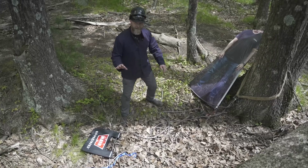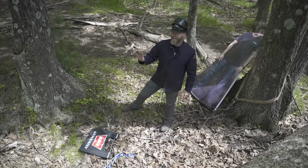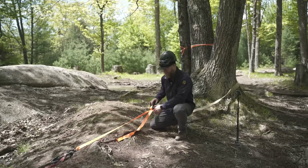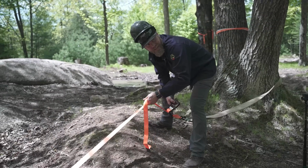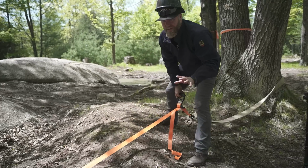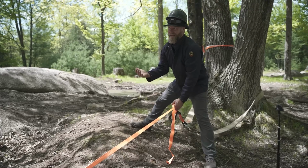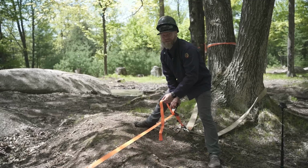Now, our next strap, these were rated at 2,000 pounds. Our next ones are, I believe, 5,000 pound weight rating capacity, so it's only going to get better from here. So this one here is the 5,000 pound ratchet strap. It took a lot to break those 2,000 pound ones, and granted, the weight ratings are always a lot lower than the actual breaking strength. That 2,000 pound one might have been, just guessing, maybe 5,000 pounds. So this one's a 5,000 pound rated strap.